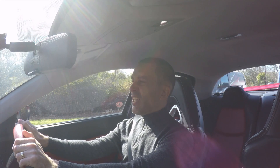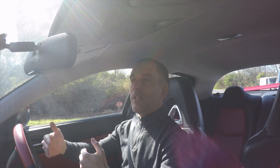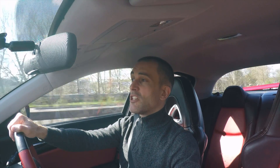Weight distribution-wise, that's really changed a great deal. The biggest difference is the weight at the front is further forward — it's in front of the wheels, so I've got a bit more of a heavy nose. But in distribution terms, all the things I've taken out — the exhaust, fuel tank, obviously with no fuel — I've put about 100 kilos in the back but taken out about 80 kilos worth of stuff. In the front, I've added the new motor, inverter, and batteries, but the motor and inverter are far lighter than all the oil radiators and the original Wankel engine. With 100 kilos of batteries, the weight distribution at the front is fairly similar.